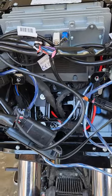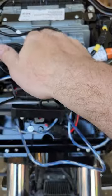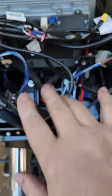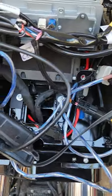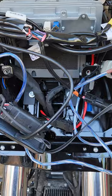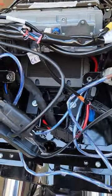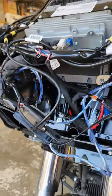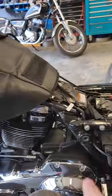Remember the toughest part of all this is: hook up everything first so you've got all your wires separate, then take that amplifier and work it up in there, then try to pull the wires around the bottoms, slide it into place, put your bolts in — get both bolts started first, then torque them down. Mr. Monkey said this was fiddly — it's going to take some definite Tetris work and some intelligence. Follow the instructions, take your time, follow your color codes. You don't have to do any soldering, any cutting, any major rearranging. I definitely want to put the amplifier on the back first because I plan to put another amp up front when I get my lowers put in. So you've got the speakers in, grills are ready, everything's run — now we're going to hook up the battery and see if it all works.